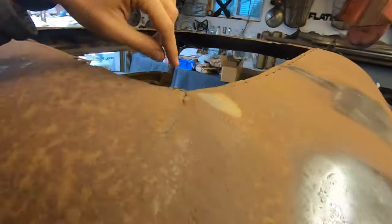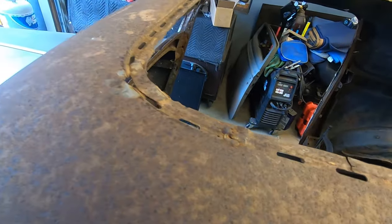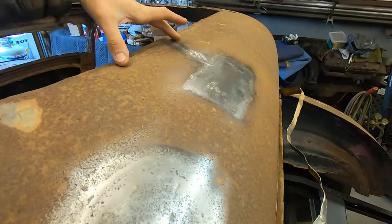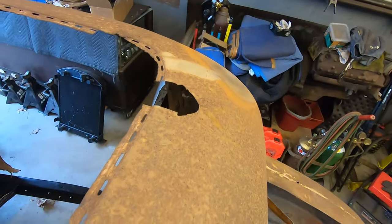Since I'm making a roof insert, I'm really not going to worry about these cracks along the edges — any of these boogers along the opening. I'm just going to make an insert probably all the way to here. Same with the back — I might make the back one all the way to here just so I can get rid of this crack altogether. That cut out over there — I can totally get rid of that. Maybe just weld up a crack or two. Then I need to work on — oh, so much stuff. I need subrails, bad.